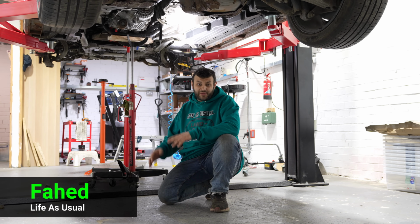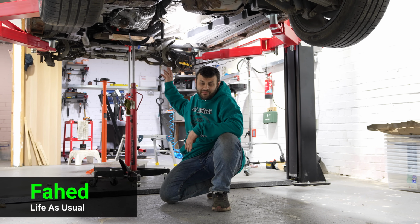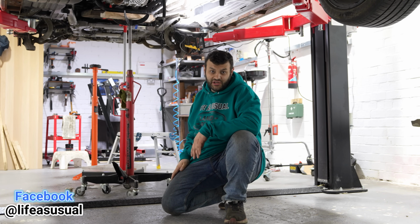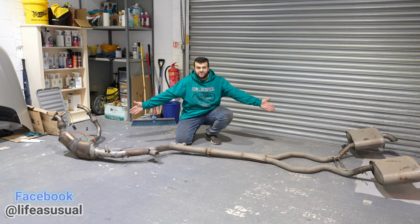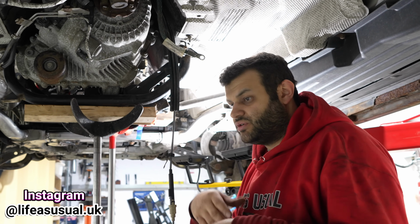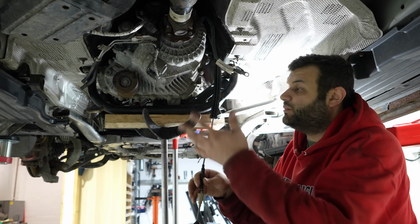But before we properly turn it on, we have to put the transmission back, and a lot of hoses and sensors in the front of the engine. And don't forget the full exhaust system. So the transmission now is bolted from the front and I put the torque converter. Starter motor is in. Obviously not all of the cables are in still.